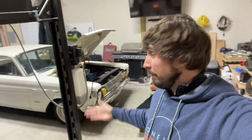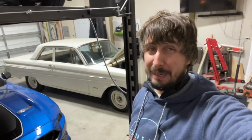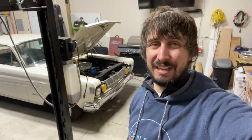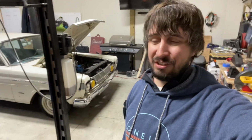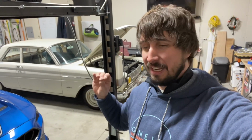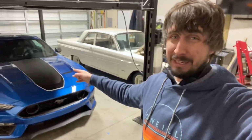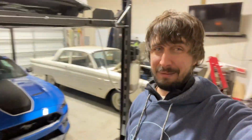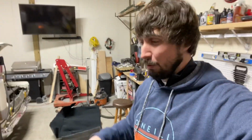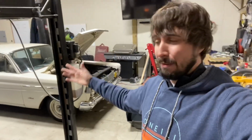We'll see. But if I do decide to go that route, we'll get a T5 5-speed in that, which will make it a ton of fun. Right now, it's a cool cruiser, but it's just doggy, and anything I do to the motor, you won't be able to take advantage of with the AOD and that shift point. Now I could put a shift kit in it and a different stall converter and all that stuff, but again, everything on my channel is a manual. My old C10s, both of them were manuals. My green truck's a manual. Everything I've ever had that's fun is a manual, so why should that be an automatic? It's just not my style.